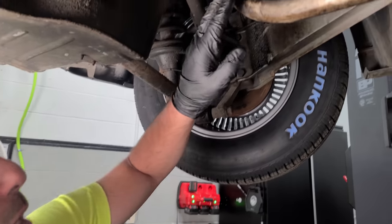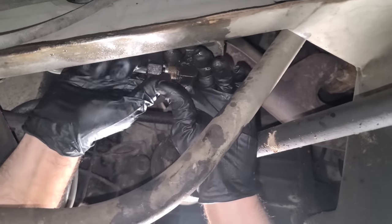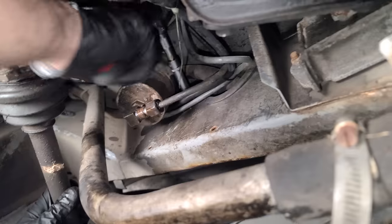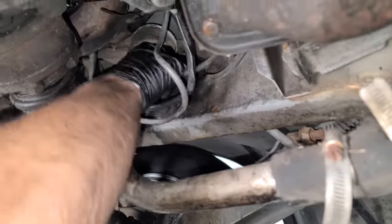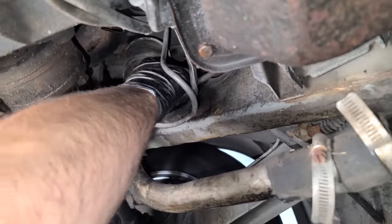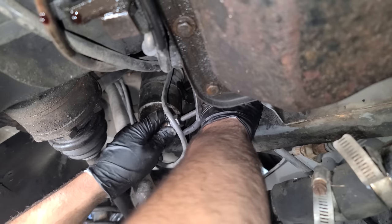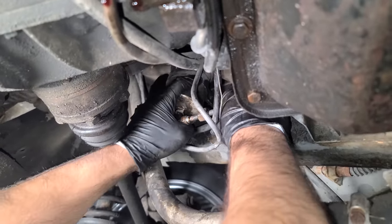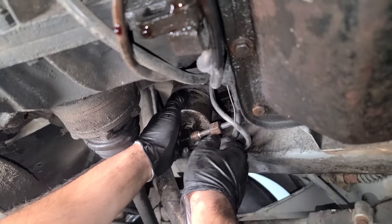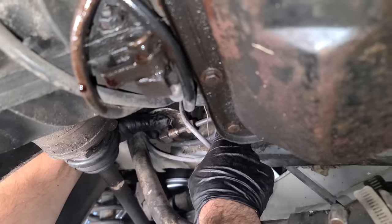Anyway, okay, we have a fuel line that is turning. All right, that's loose. We haven't broken the seal yet, I don't believe. Okay, I have that nut off, and now we have to remove the clamp. All right, I've taken out the hardware to loosen this up. Okay, there goes some more of it. All right, now that that's loose, we should be able to get this line off. Man, it's like frozen. Look, we have the nut all the way back. It's literally just frozen in there. And you can see some of that molasses. I want to be gentle with these lines. They're in good shape. They're not rotted out, but you can still crack one.